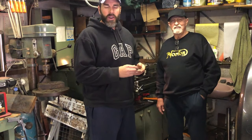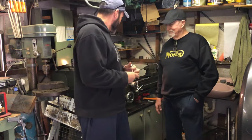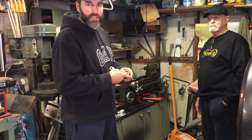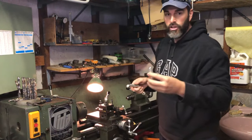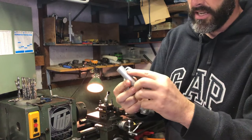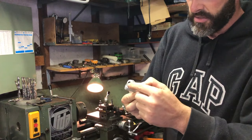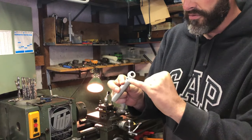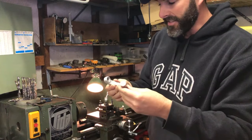I've nipped up to my old man's garage — he's got a lathe. Here's my dad Kev. I found a bit of scrap aluminium and all I need to do is machine the OD down so it fits inside the gear lever recess, then face it off, put a 6mm or quarter inch hole through the centre for the bolt, and part it off to the right thickness. I probably could buy one at a hardware store but it's more fun and I know it'll be spot on.